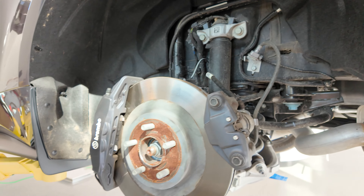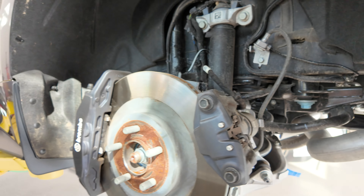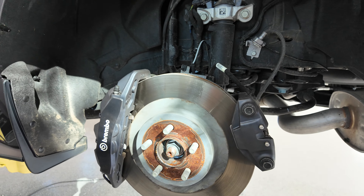I just tried to test-fit the Weld wheels and, kind of as we feared, they don't fit with the factory brakes. I think what we're going to do is replace those factory spindles. In order to make the rears work, we're going to have to get the lower model spindles — the base model spindles are smaller, or they'll have more clearance, whatever it is that we need to get this drag brake package to work. Unfortunately those don't fit with the stock brakes. You buy the Plus model and you have these nice big brakes, but they don't work. So we talked to our friends over at TBM — they're going to send us a brake package for this car, but we do need to use the base model spindles in the rear to get those to work.